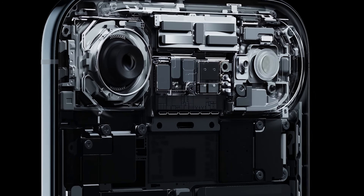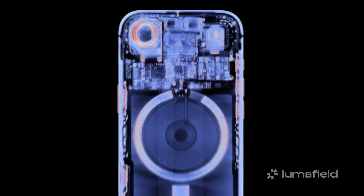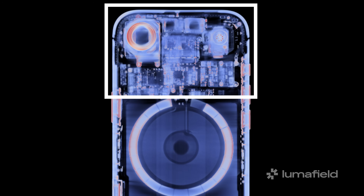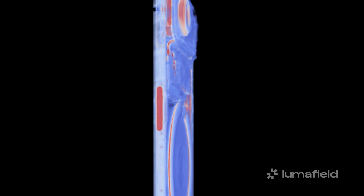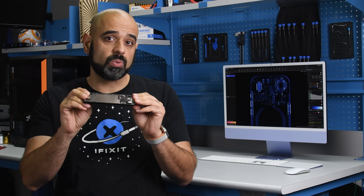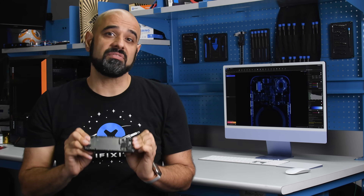When we got a sneak peek inside the iPhone Air during Apple's keynote last month, we noticed one huge design change. Our Lumifield CT scanner confirms it — the logic board has been repositioned, spilling partially into the raised camera plateau and making room for that gigantic battery. Moving the board further up in the chassis helps the rest of the phone stay impressively thin and protects it from bending stress, potentially preventing another bend-gate situation like we saw with the iPhone 6 Plus.